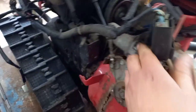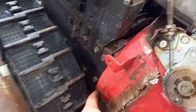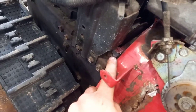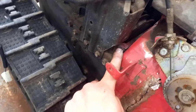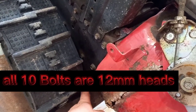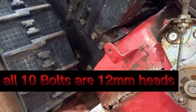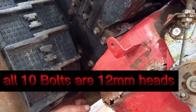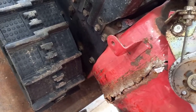There's a series of eight bolts holding the blower on the front of the snowblower. On both sides it's the same: a 10 millimeter head, another 10 millimeter head, two more below it — so one and two. And then on the very bottom underneath, which is awkward to get to, there's another 10 millimeter bolt. At that point the front auger should just slide off.